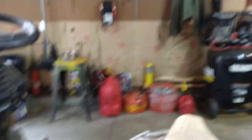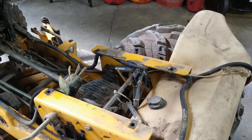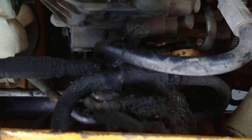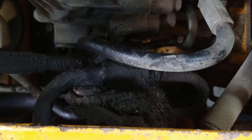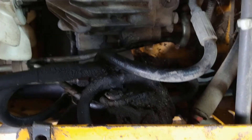Now that the fender is off we can see everything we need down in here. Let's just confirm the drive shaft is actually turning — yes, drive shaft turns just fine. A problem area to be aware of while you're in here: hydraulic leaks are very common from the spool valves. This one's been leaking for a while — not terrible, but I'll probably take care of it. Under heavy use, this particular spool on my tractor leaks about every six months. I think the machining tolerances are poor — this spool is probably worn or was improperly machined because it goes through seals quickly.